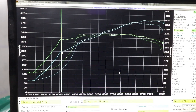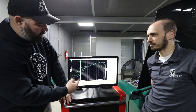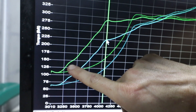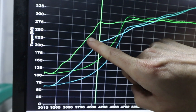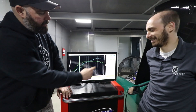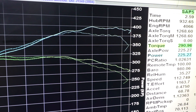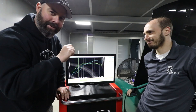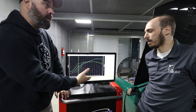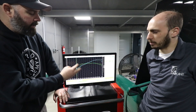Here are the results: a nitrous run versus a non-nitrous run with the GTX 3071. The nitrous is only active in the very bottom part of the graph, shutting off around 16 PSI. You can see the ripples showing the first and second stages shutting off — after that point it's all turbo. The peak-to-peak difference between nitrous and non-nitrous runs is due to ignition break-up from loose coils, not the nitrous itself. Everything at the top is essentially identical.